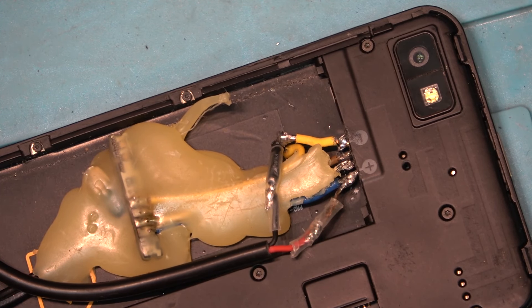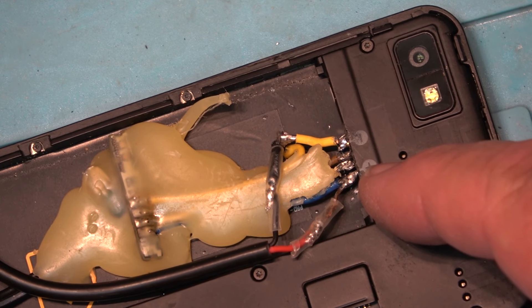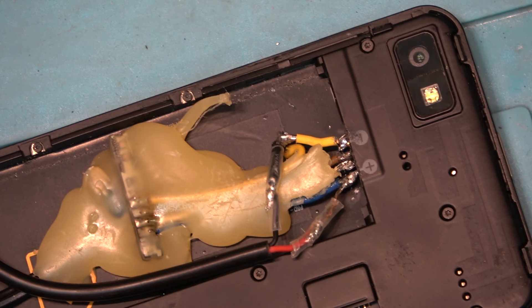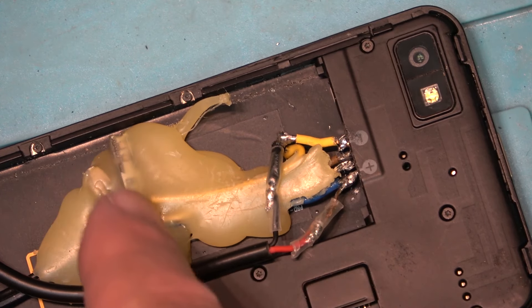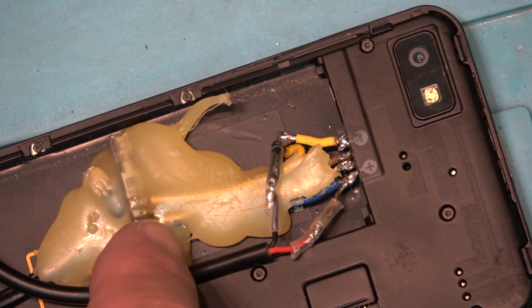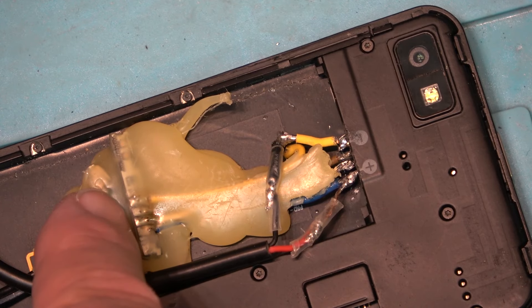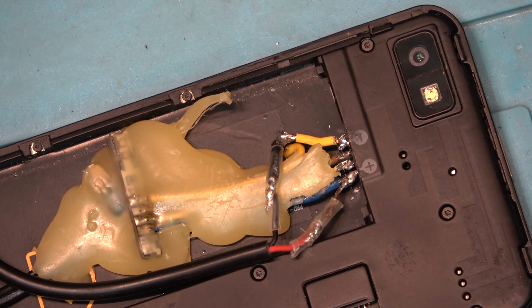It's such a simple hack to make these old devices operate on power. I just want to use it as a desk clock. You can't just connect the positive and negative — it'll shut down with a message telling you it needs a battery. It doesn't actually physically have to have a battery; all it has to have is the chip that's in here. This is part of the original battery — I cut that out. For years I was thinking I actually had to have a battery. I don't. All I have to have is power and that chip, and it works. Pretty neat, huh?